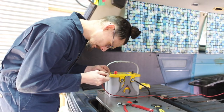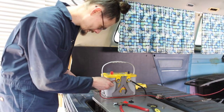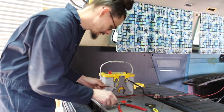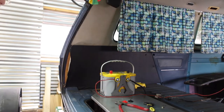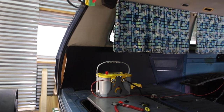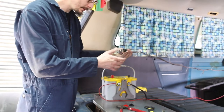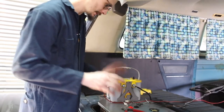There are our connectors. We're going to use the Metropack connectors and the open barrel connectors to repair our harness — tap into it at a couple of different places and get ready for the rest of our electrical work. We are about to hook up our temporary power. Hopefully we don't get sparks. That's the doors open and keys in signal. Now that we have our temporary power, we can hook up the wiring harness and the lights, repair the broken spots, patch in the plugs, and tidy up the back half of this harness.